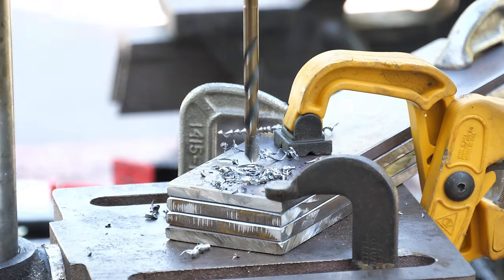We'll stick these together on the inside and outside edges, then once they've cooled down, use a flap disc to hide the crimes and make them look nice. As usual though, I seem to have underestimated the ability of welding to move metal around. Those sleeves that were a nice fit are now a little bit snug. I'd like to have a little bit more leeway, especially since I'm gonna paint these. But we shouldn't have any problems using a pair of bolts to get ourselves a little bit more room.